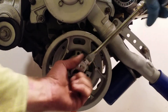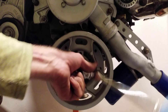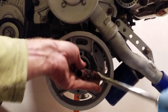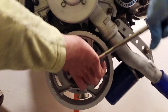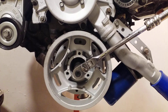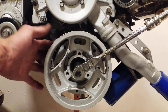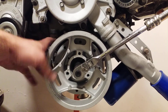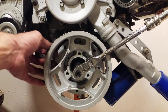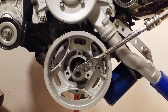I don't want to give you any false information on the exact torque specs, so you're going to have to look that up online. But that is how you change a harmonic balancer dampener. Once you have that swapped in and out, you're still on a 3.8, 3.9, or 4.2 — the 3.9 and 4.2s are externally balanced like this balancer. That's everything on the balancers — how to remove one and what you need for the FE swap. This has been Paradox, thanks for tuning in.